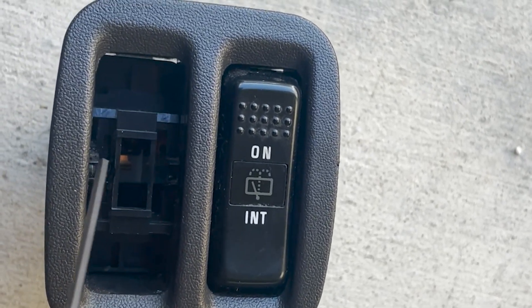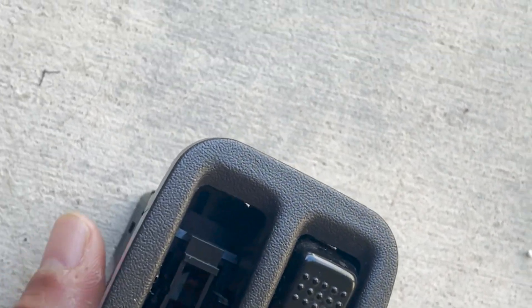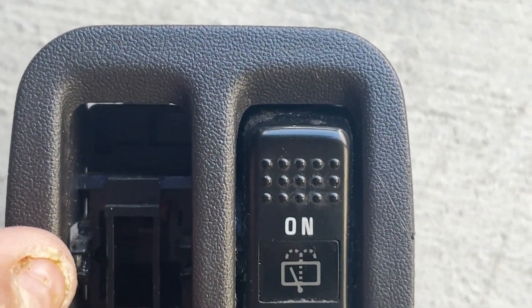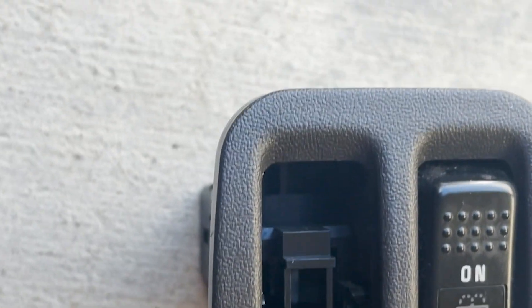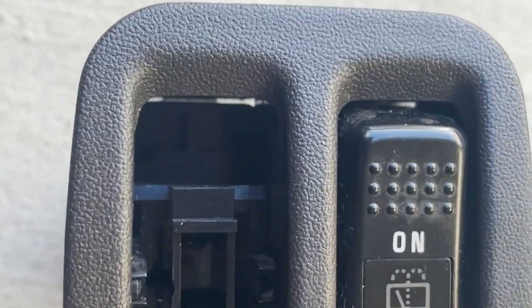There's a spring here. The spring goes in the center hole and right on top of that the steel ball goes. What happened was I tried to put this switch on my car and it looks like both tabs on the sides are broken. Here at least one of them is fine, the other is broken. So inserting the switch will be a little easier and it will also hold in place. I'll have to take the entire switch out of the car and replace it with this one.